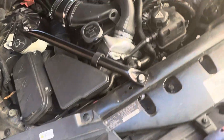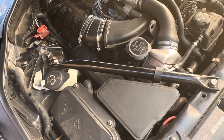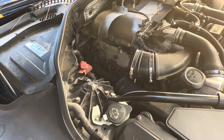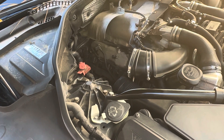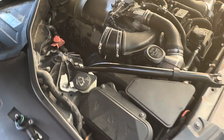I hope this helps with y'all's issue. So again, that's for those codes — P112F and also P0171. And that's on bank one, which is your passenger side. Hopefully this helps with y'all's issue.